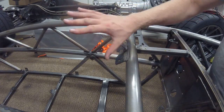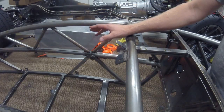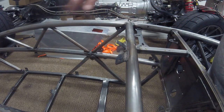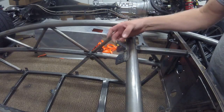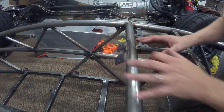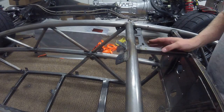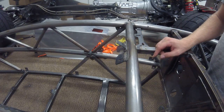The last little one here is a tab for the gauge pod. It really just connects at the front two points and was unstable enough that at speed it would flap a lot. So I welded this tab on here and drilled a hole through the back of the fiberglass gauge pod, allowing a third attachment point for it. That keeps it much more stable — it actually made quite a bit of difference, which surprised me.